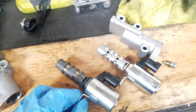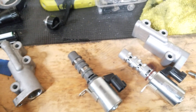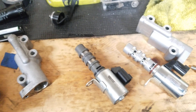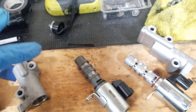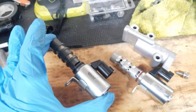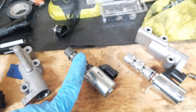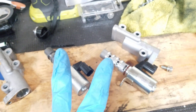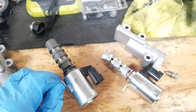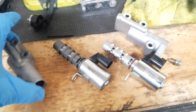What happened on this vehicle was a P0011 and P0021. I did a timing job, the timing chain is all good, and the only other thing I changed was this solenoid. When I got the ohm readings they were reading differently. I wish I had a tablet where I could see the advance and retard of timing on both banks simultaneously. I'll put a link in the description to a Ford mechanic who did a phenomenal job showing how a P0011 and P0021 can result from just one bad part — if one part goes bad, the other side overcompensates and throws codes for two separate banks. Dealerships like to replace everything in pairs, but a mechanic is actually going to troubleshoot and figure that out.